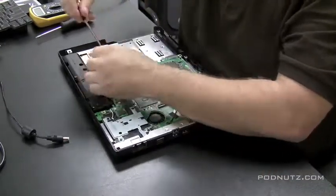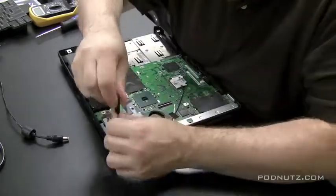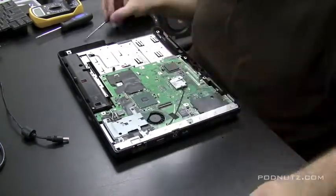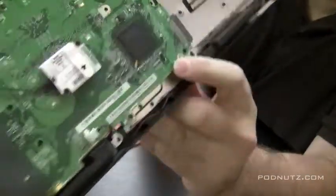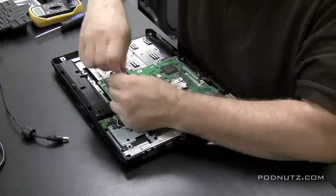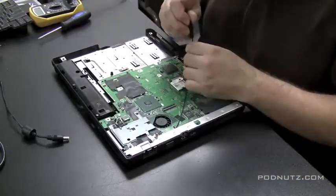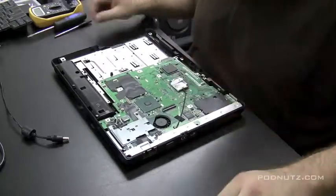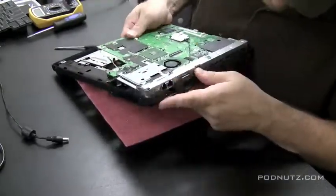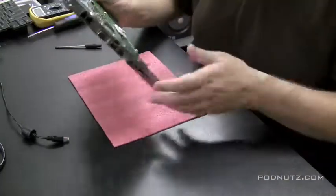To fix this we have to take the motherboard out, because we need access to both the top and bottom of the jack. On this motherboard, white arrows point to the screws you need to remove to get it out — only the screws next to the white arrows. I didn't need to take off the fan, the PCMCIA slot, or a few other things — just followed the white arrows and took out those four or five screws.